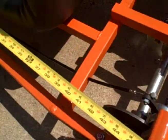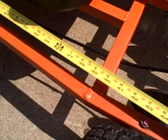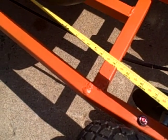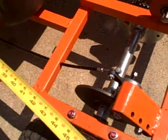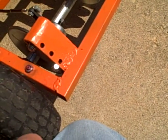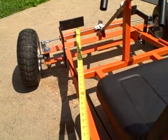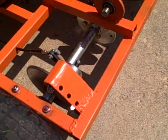That's because this is just one single 48-inch length of pipe that was cut and welded on the angle right back here. And then in the back, two 1-inch square tubing was welded to the ends. So you've got your 48 inches and then the tube in the front and the tube in the back to give you your full 50 inches.